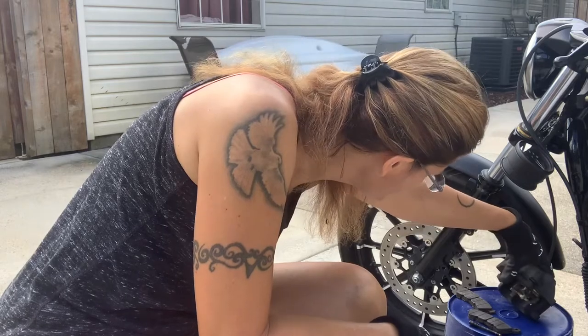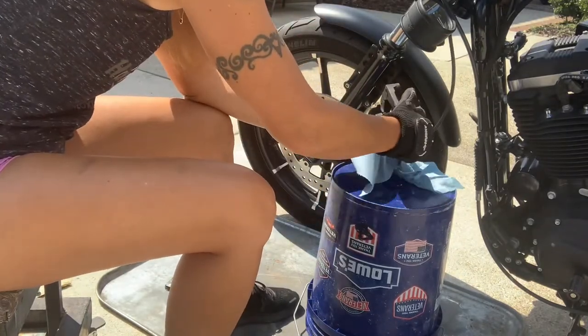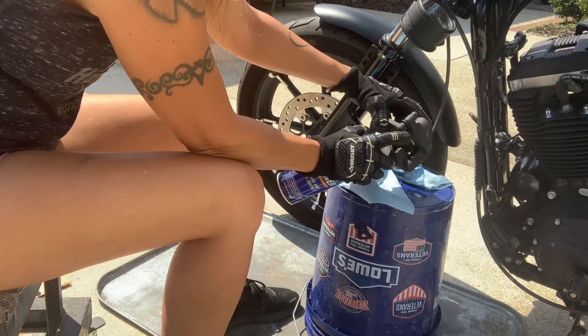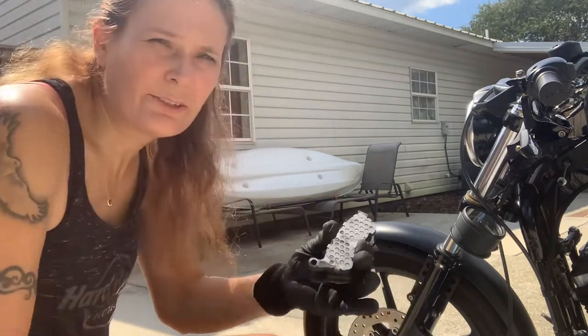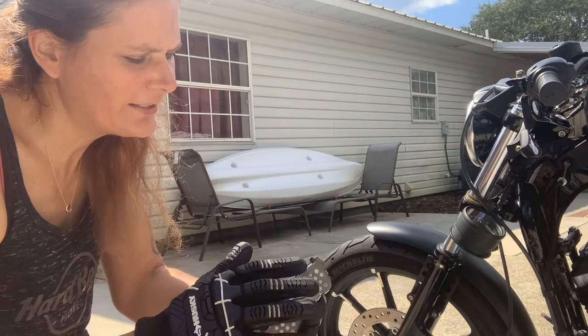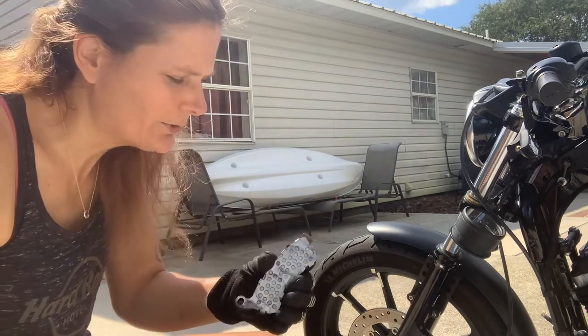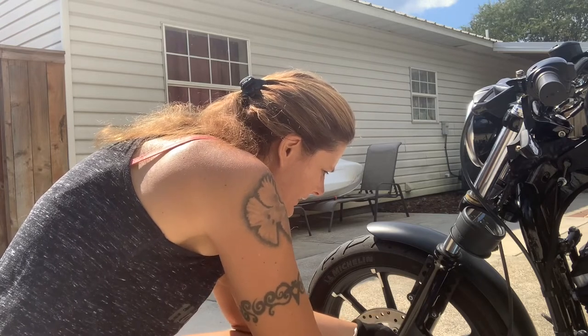Now I'm going to grab a soft brush and some soap and water to clean the inside of this caliper out where all those spider webs are. I sprayed a little brake cleaner in there just to make sure any soap and water was out and dried up quickly so nothing's going to rust. Also on Harley brakes, this heat shield on the back is removable — there are little clips and you can pull it out and clean that too. Mine looks pretty good so I'm not going to worry about it today. We'll just use the outer pad to press the caliper back in.